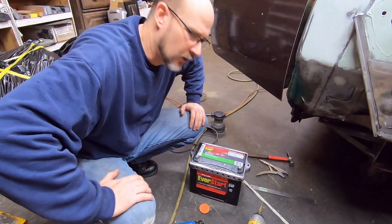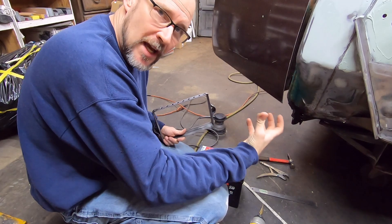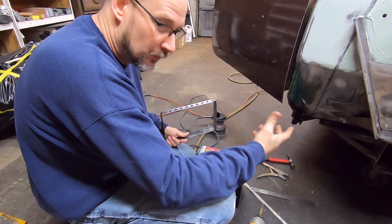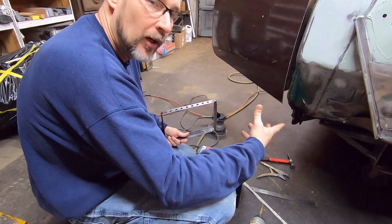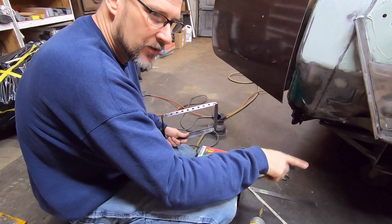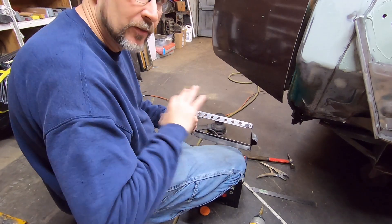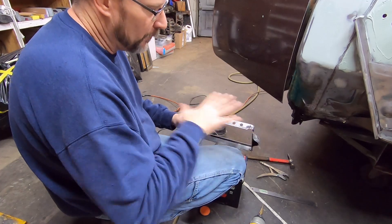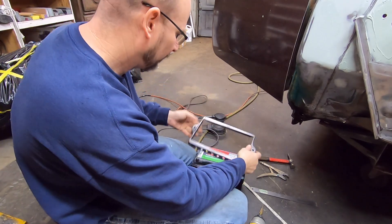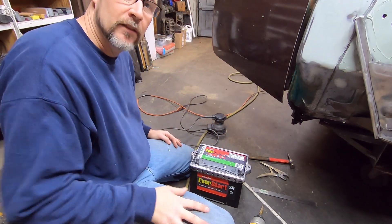I might have another idea - great, more detail. I've got some old Bel Air aluminum dash trim inserts that go in the Bel Air 55s. It has all the bow ties on it - I have a bunch of those, centerpieces and corner pieces, some of them pretty rough and beat up. Nowadays people just buy brand new sets, but I've got some that were pretty rough and I cut sections out and used them in my hardtop. So I might go in here and epoxy some of those on the back side of that lid, polish them all out to where the bow ties aren't black, then paint this satin black and epoxy in that row of all the little bow ties together. I might do that or I might just leave it open - depends on how I'm feeling when I get that far. Speed holes are always cool, man - I love that stuff.